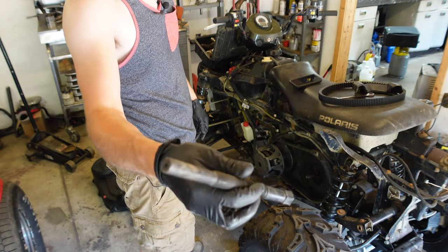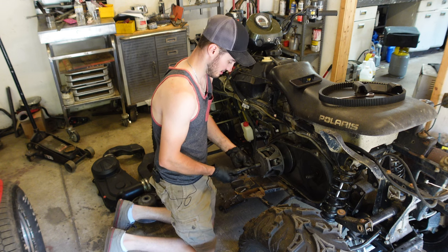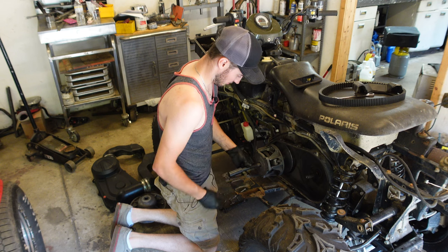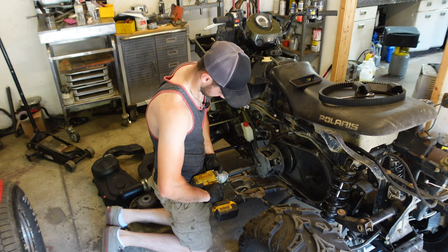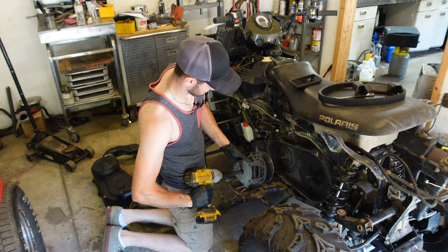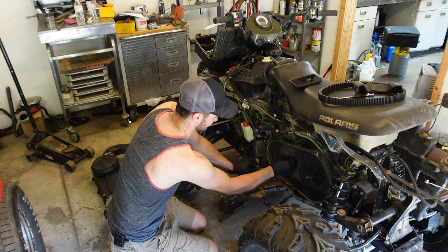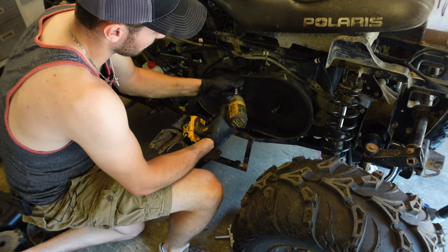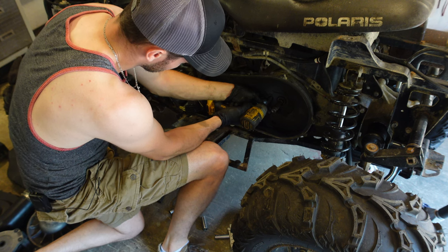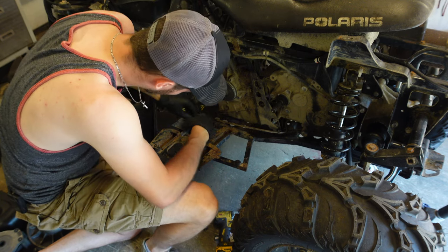Here's your primary clutch puller — these things are a lifesaver. For the tool, it's a 7/8ths socket, or a metric size that's ever so slightly loose but it'll work for our application. Once the clutches are out, you just have a zip tie on the backing plate — it's not even tight. To get the back plate off, it's 3/8ths bolts all the way around. Cover is off.